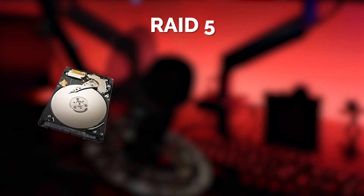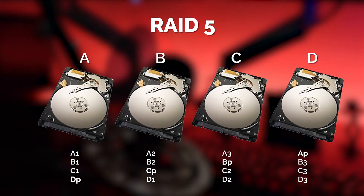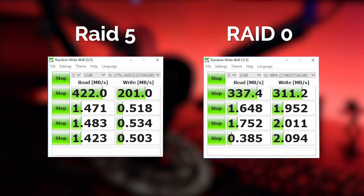This leads me to my actual recommendation and the whole point of this video: for video editing, you should go with RAID 5. RAID 5 uses three to four hard drives — usually four minimum — but instead of losing half your capacity, you only lose about 25%. This is because instead of full mirroring, you have what's called parity, where a fraction of each drive is backed up across the other three drives, as you can see in this illustration. So if one drive fails, you can replace it with a brand new drive and repair the array without losing data. Beyond that, RAID 5 is also very fast since it includes striping across multiple drives. It's not quite as fast as RAID 0, but my RAID 5 external with USB 3.1 Gen 2 is actually faster than my old RAID 0 was.